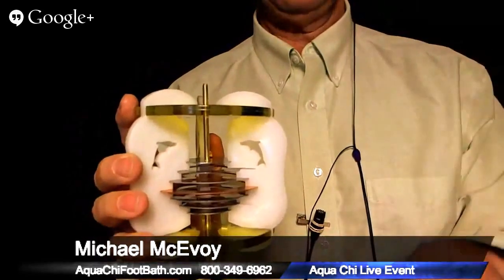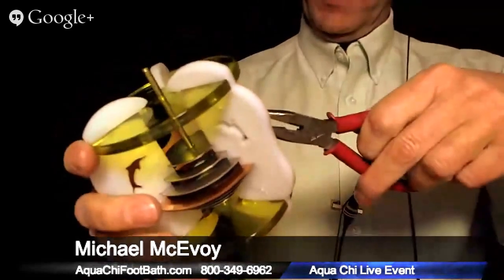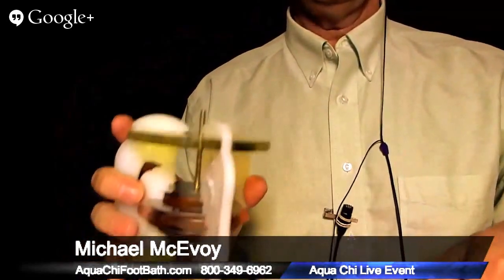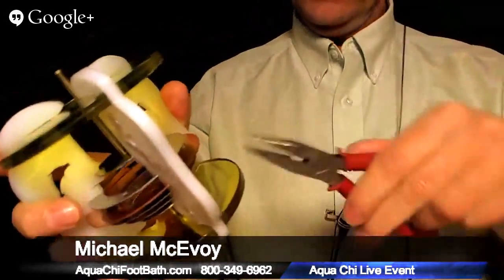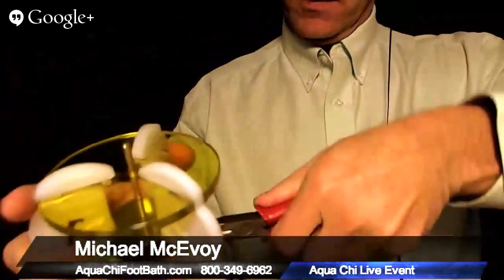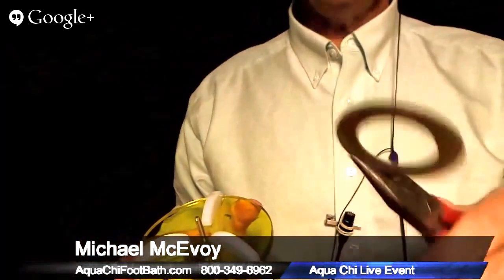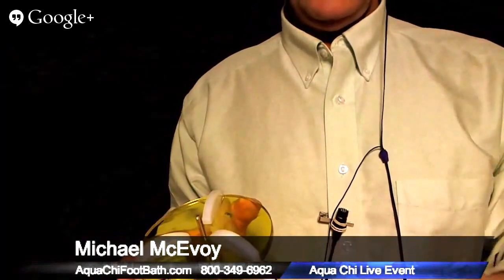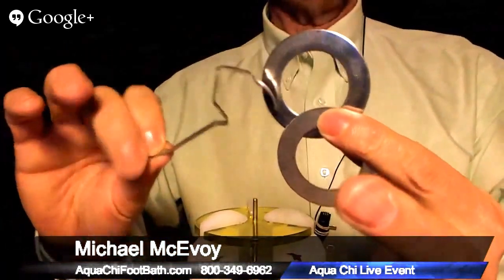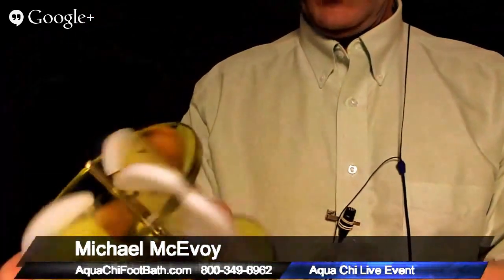The clip comes out. And then I like to use a little pair of pliers because a lot of times those ring sets, when they're used, they get a little jagged. This is a new one, but I grab them with needle nose pliers, and then they slide out a lot easier at that point. Get that one. Which way am I pulling it? There we go. That was a little more stubborn, that one. Anyway, so the ring set is these two rings and a clip. Some people call these strips, but I call them clips because they're clipping the two rings in. Now, let's go ahead and replace the ring set.